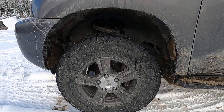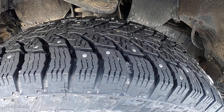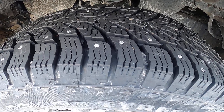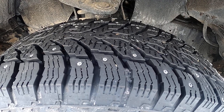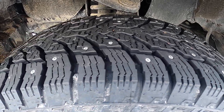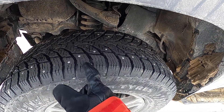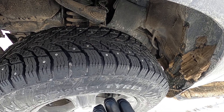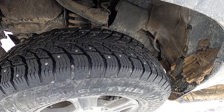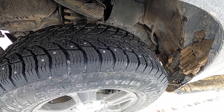These tires are really good in the winter because they have the Nokian studs installed at the factory. That's a big deal because a lot of places they just stud them using a gun, but with these there's actually a plate underneath the rubber that is a little more substantial than a regular tire, where you just have a little extra flange to plug the stud into.